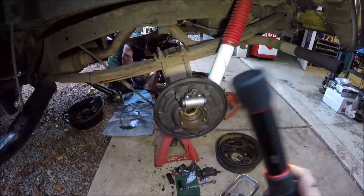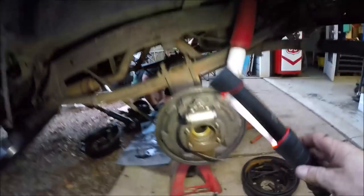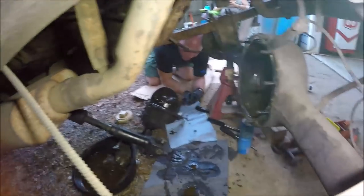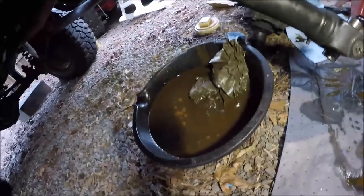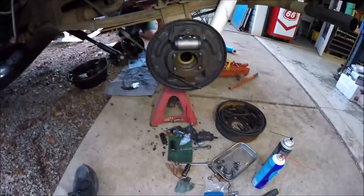Well, Brad and myself and Jessica are here. We're trying to get this rear end knocked out. Figured I'd bring you guys up to speed. So we got it cleaned out, new seals in it, putting in new wheel cylinders, all new brakes. Brad's over there. That's what the third member looks like for you guys that aren't familiar with the 9-inch. And we got the, get some light. Center section cleaned up pretty good. Now if you see the chocolate syrup that came out of it. I'm surprised the bearings have lasted, but we are slowly making progress. So I'm gonna get this thing together here.